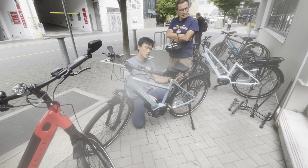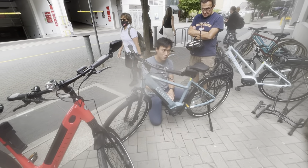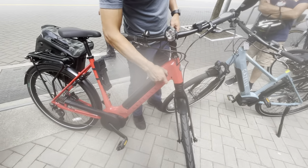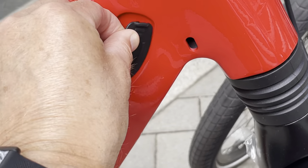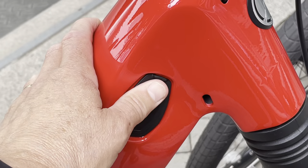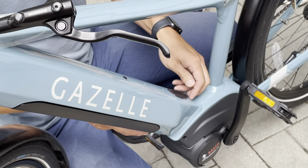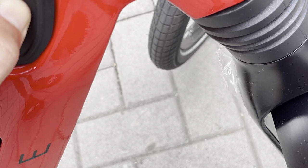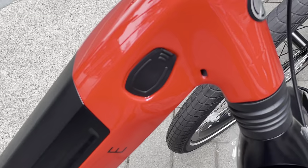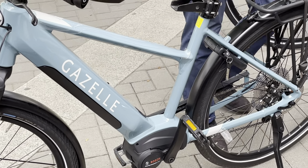You can also charge the battery while it's still attached to the bike. If the power source is nearby — within about six feet — just use the charger that comes with it and plug in right there without removing the battery, which is very convenient. The charging port is right here — get it open. When reinserting the battery, note that the little click mechanism is not centered. Find the pressure point rather than pressing the middle — if you keep pressing the middle it won't secure and will keep flapping around. Find that small nozzle point and it clicks in easily.